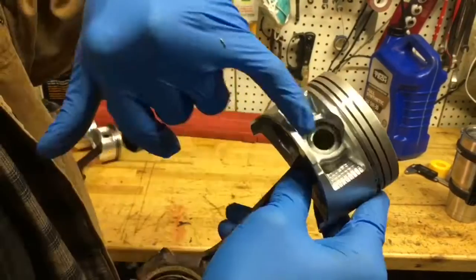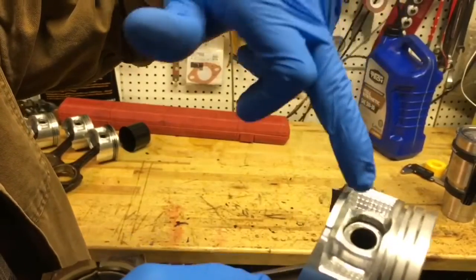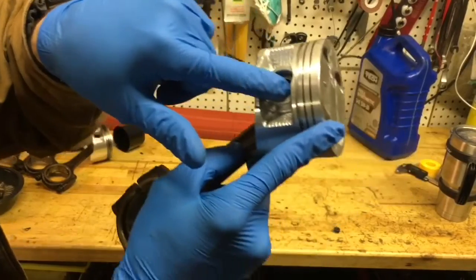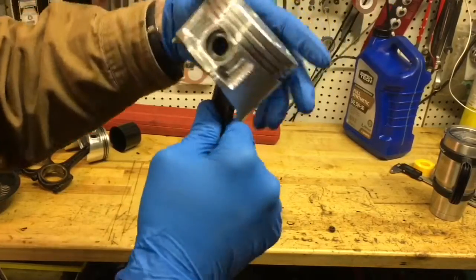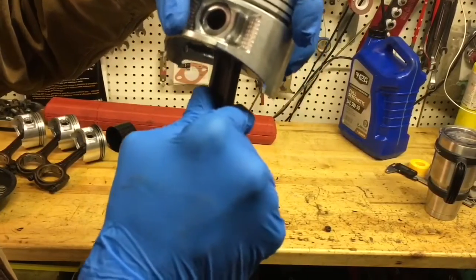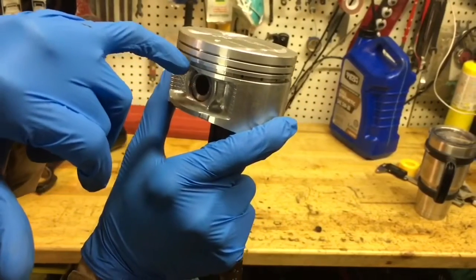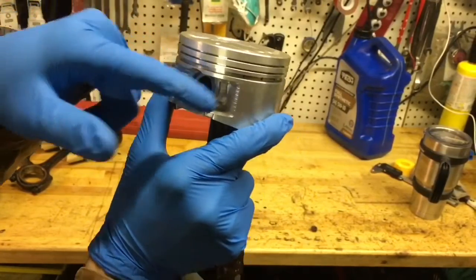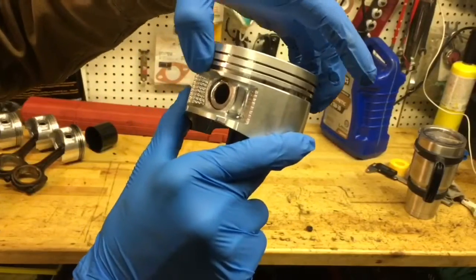I've beaten these in. I messed up and actually hit a little bit off center with my socket and it gouged this. So I took a pencil grinder and just hit the low spot, just enough where there's no play left to right or up and down. Then it pushed this up just a little bit, so I took a small hand file and just hit that back down just enough where the gap opened up where I can put a set of rings back in here.